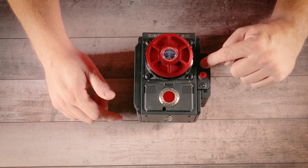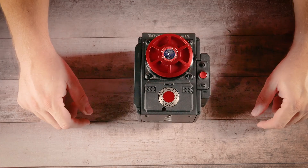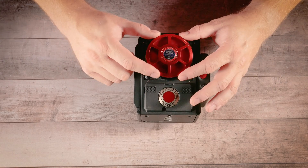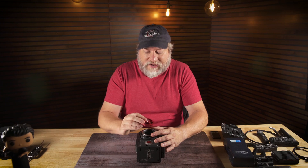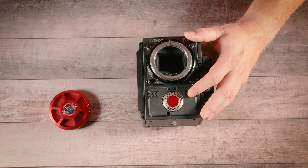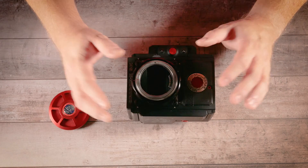There are two customizable buttons here — you can set edge focus or false color record button. This is an EF mount, but you can put a PL mount, a Nikon mount, all kinds of mounts on here. This is a GDU lens cap — they make really good aftermarket products started by RED President Jared Land — and inside you can see the Red Dragon sensor. The EF mount comes off with four screws, easy to swap. This is aluminum, so be careful. I wouldn't hang a large lens without lens support, but a normal lens runs all day. It is an active mount, so it will control focus by wire.